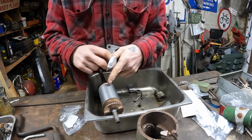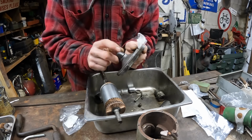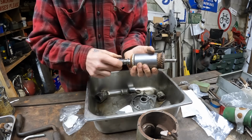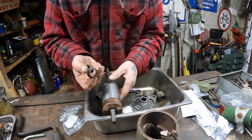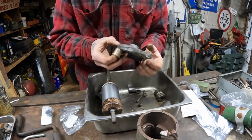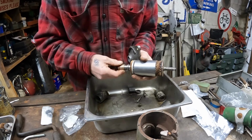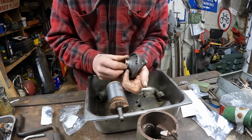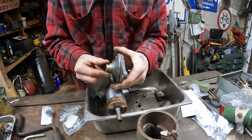Now I went down to Solent Bearings and got this, but it doesn't even go in there. I could probably jam it in there, but also, unfortunately, it's way big there, it's rattly there. I don't know what happened there, the guy measured it. Anyway, I looked at this, and the actual wear in it wasn't on the ID. This ID is quite tight. The wear is on the OD. And look, you can see that bit of wiggle there.